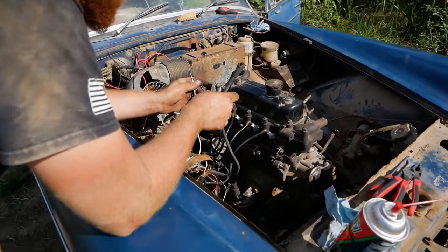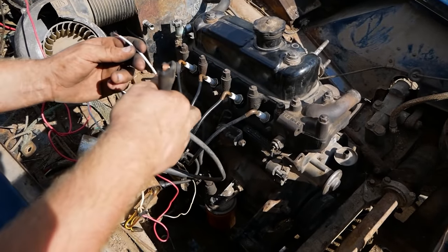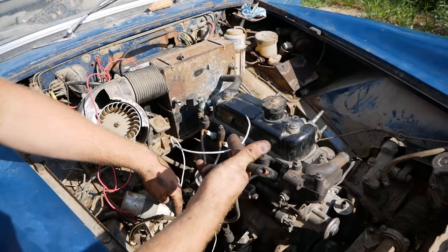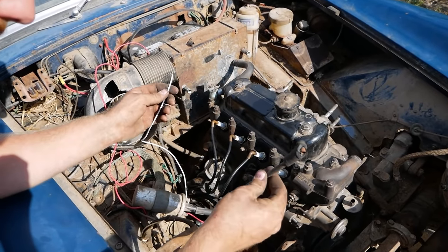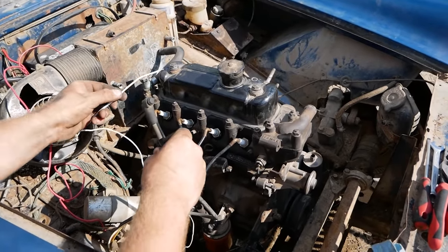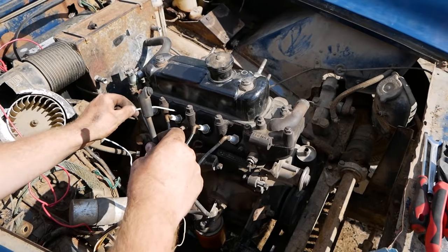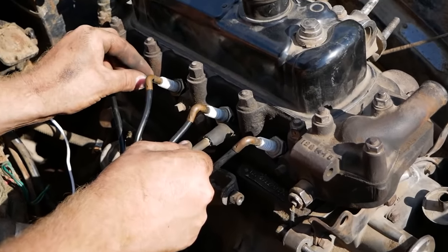Good stuff. Let's hook up an ignition system, throw a little fuel down its throat, and see what happens. Before we try to light this thing off, we're going to see if we have spark at all. I have 12 volts from the positive side of the battery, ran to the positive side of the coil. I've got a spark plug wire I found laying around, cut up and jammed in there. And then I have a wire from the negative post of the coil that I'm just going to ground out. You can see that that guy over there sparks. So, if I go here...